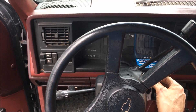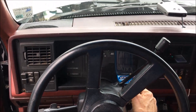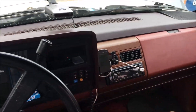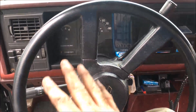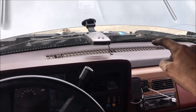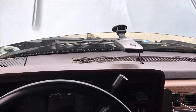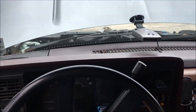I'm like, well, what's going on? I came back in here and looked for a breaker, looked for a fuse — there's a fuse box down here, they were all good. I tested them with a meter, tested the battery with the multimeter — read fine. I tested all the fuses with a meter tip — they were fine. There's another relay box covered up inside the engine housing — pulled that, looked under that, looked everywhere I could find, looking for a fusible link, which is what I thought might be the problem.